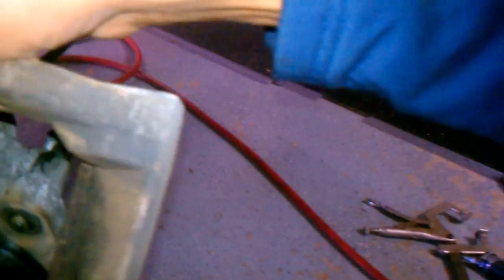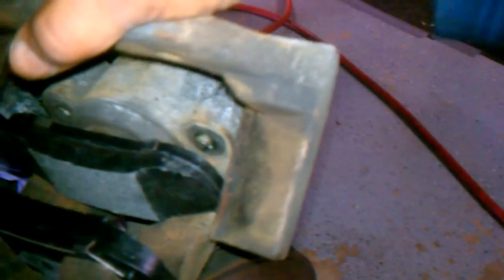Now, like most brakes used to be, they'd sit in the back of here in this little hole on the bottom, not the top hole, that's to mount it back onto the bracket, but the bottom one, that's where they go into. If those were still there, you would not be able to put this in here and angle it, see how it's falling into place, and be put on like so if those pins were there. You can see how if the pins were in, you wouldn't be able to do that because you would have to try to put it in at an angle and try to slide it in this way. But those pins come out, okay?